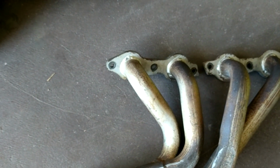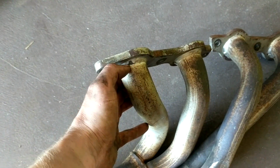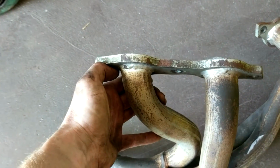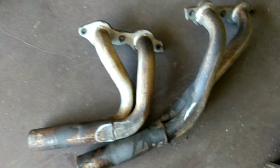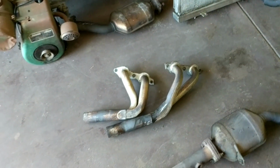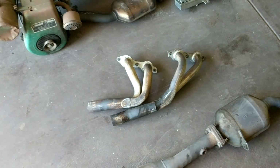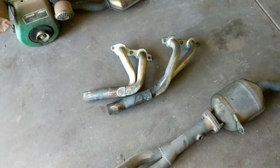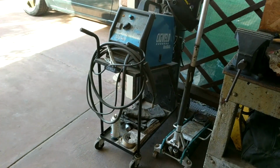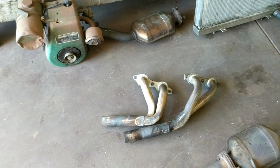I've got to move it in about 10 mil. So yeah, if I chop them here, I'll be able to re-weld it on. 10 mil is pretty much as far as I can go due to the radius there. So fingers crossed that works, otherwise it's going to be full custom jobby. There is one of the drifter boys makes a header kit. You got to weld it to yourself, but it all fits up, so that's the next option, but I'd rather not. So yeah, unfortunately I've got to cut it and weld it, so it'll be testing out my fab skills, but I want it to fit nicely, so got to do things properly.